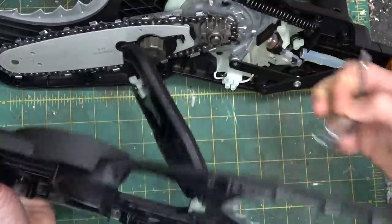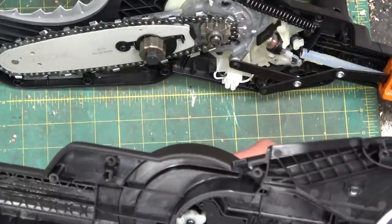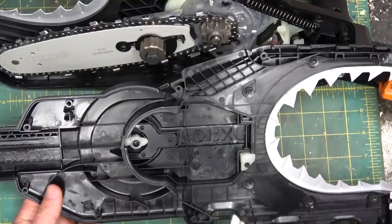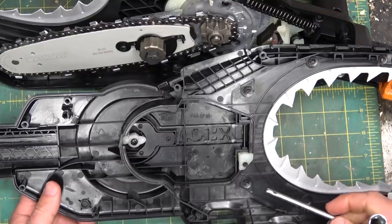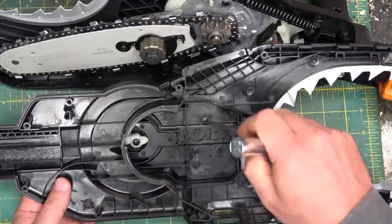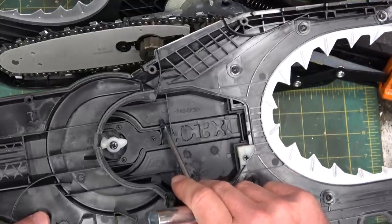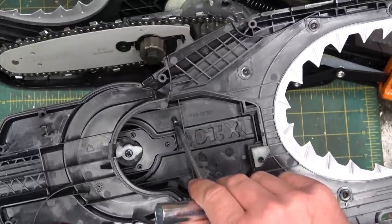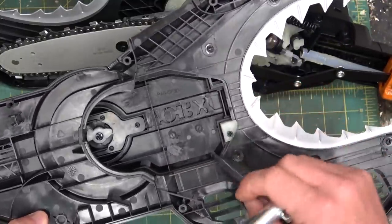Let me get my fidget spanner. Yeah. And then there's this thing, I'm still aghast at what you would ever use this for, but no account for some people's kids. So we see on here, the mold itself has been retouched. Oh, I see. Okay. So they've marked the recycling mark for PA6 with the glass fiber, but also because this is a secondary assembly, they've changed this. And this, very likely, used to be PP, and they changed it over to glass fiber reinforced nylon. You see in here, that's been knocked out by the tool and die maker. And quite a bit of hand polish on this little part.